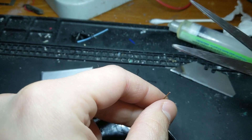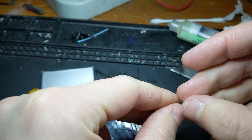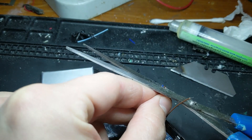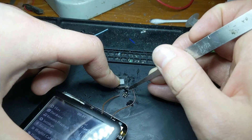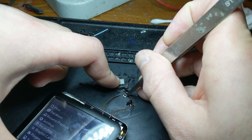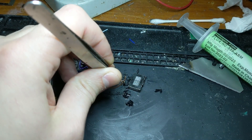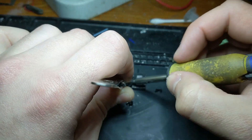Next we've got to strip down the ends and expose some of the wire — I usually just do that using my scissors. Now just wiring those up to the Taptic Engine. I couldn't actually find the pinout for it online so I just had to guess. Luckily I found it pretty quick. For the iPhone Mini one, it's just the pads on the outside of the connector, which also happen to be the largest pads. I forgot to take a picture of it up close but you can pretty much just copy what I did in the video.